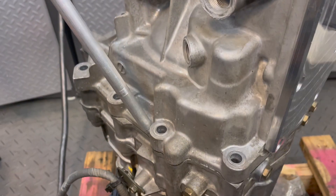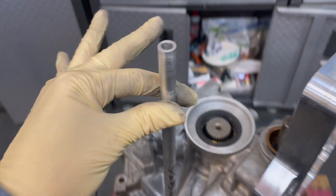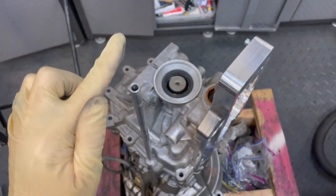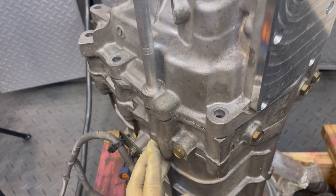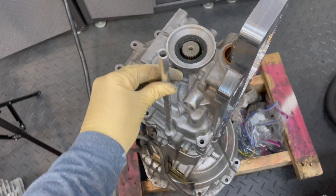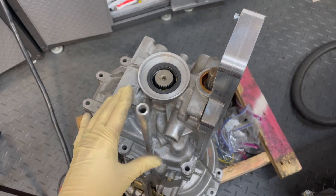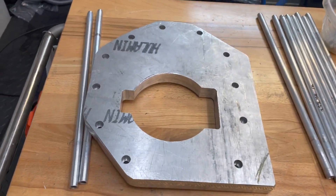The reason for that smaller diameter is so it can fit over here, and then I can have all these dowels with 8 millimeters down the center. So we'll have 8 millimeter rod going through here all the way into the main threaded parts of the transmission, which will hold this back section on and also bolt on this adapter plate for the transfer case.